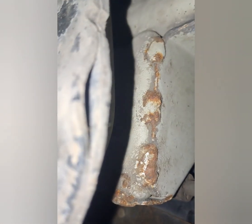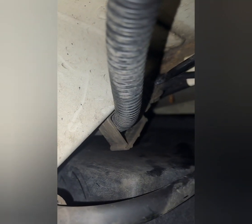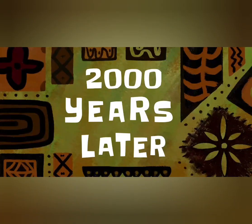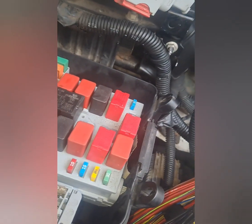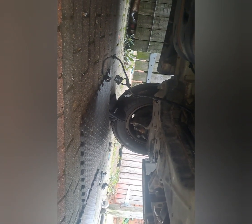I'll give you an update — like and subscribe and get in touch. Although this isn't what I do, I've got to fix it. Two thousand years later — an update. What I've done is isolated the circuit all the way back, put an additional fly lead in just between here to make sure I have enough. I've completely disconnected everything on the back — all emissions-related sensors: the oxygen sensor, temperature sensors, the DPF pressure sensor, the vaporizer glow plug connection.